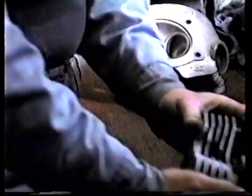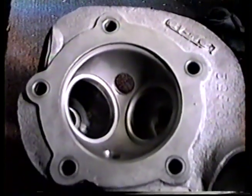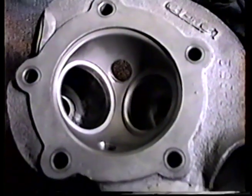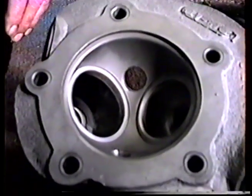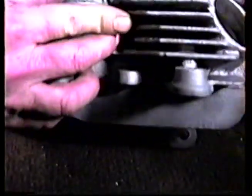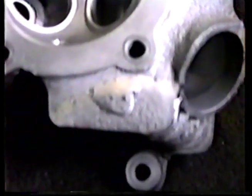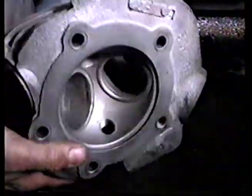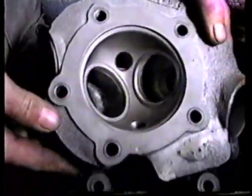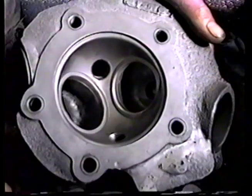When they're all done, if you want to come take a look at this other cylinder head, this is one that's completely finished as far as the head bolt threads are concerned. We've got these head bolt inserts installed in all the holes. Both of these fins have been replaced — we welded this one back on and that one back on. We dual plug these heads as well. I think we're the only people in the world that have taken the time to dual plug knuckles. Here's what it looks like from the outside.